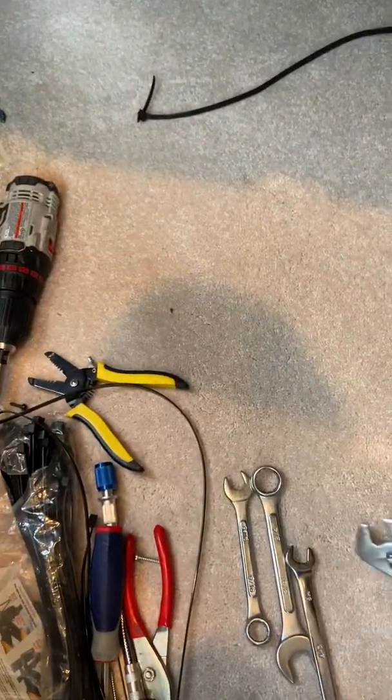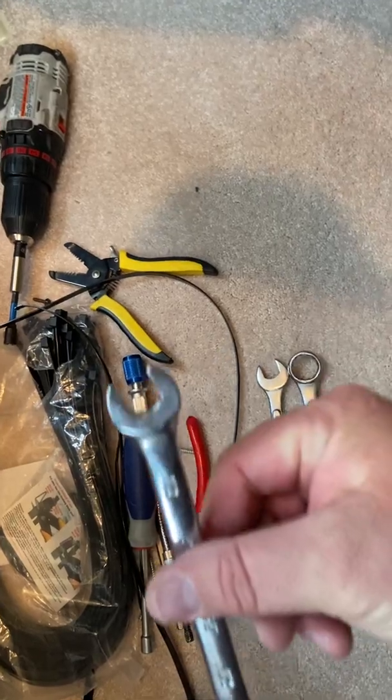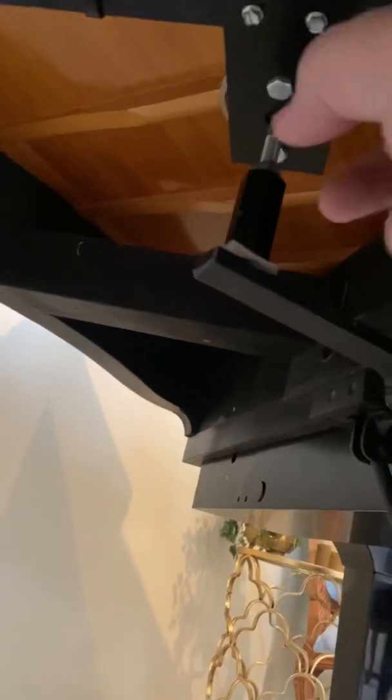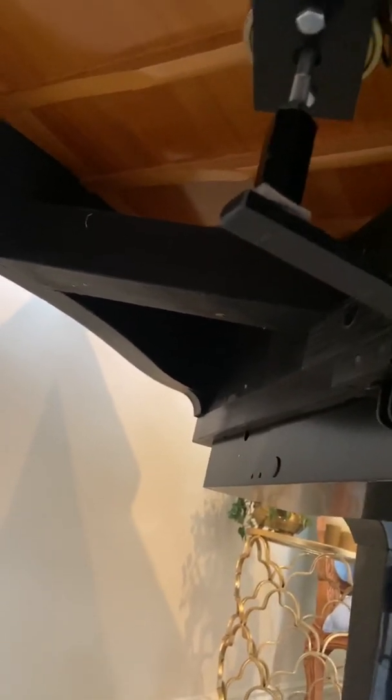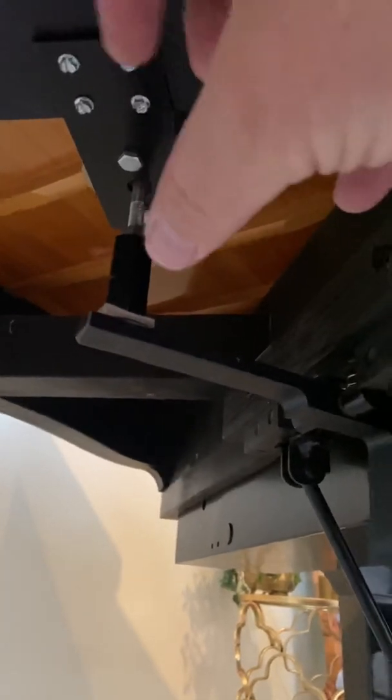You can get under there — just get your crescent wrench, I think it's a half-inch on the nut with the older system. Grab two crescent wrenches if you want, then get under here and loosen that nut right there and that one right there. Adjust it until it sounds better to you — you don't want a lot of slop. Basically about a half inch of movement equates to an eighth of an inch with the dampers, so just adjust that a little bit until it doesn't make a bunch of racket.